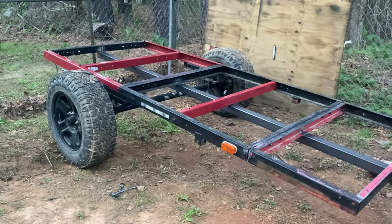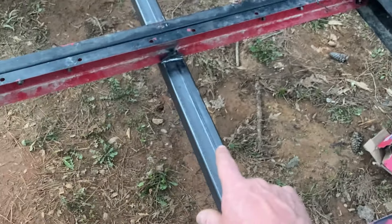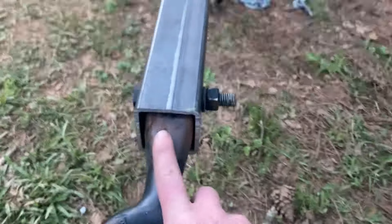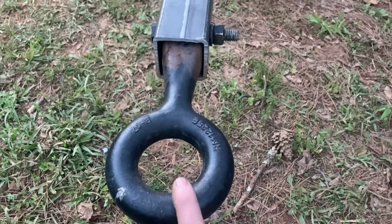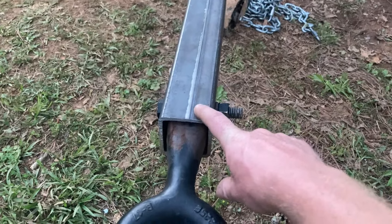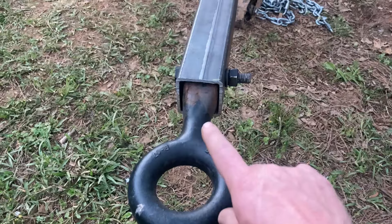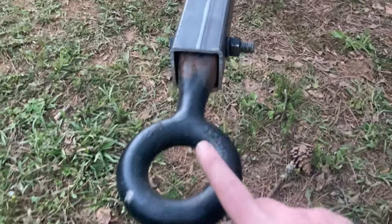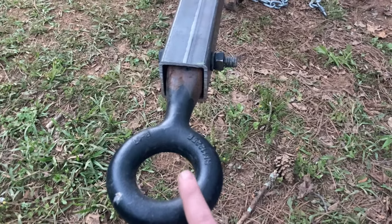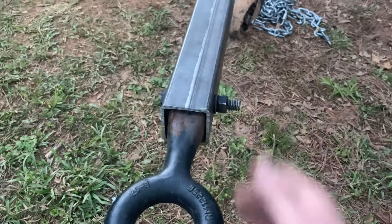I still have the 32-inch Jeep rims and tires with the 5.5 lug pattern and 3,500-pound axle from the original trailer. I've added a piece of two-and-a-half by two-and-a-half tubing with a 3/16 wall — that's the only tubing the steel yard sells by the foot. This fits the original lunette ring and also accepts the tractor supply two-inch ball hitch. I can swap it with one pin, and removing it is part of my security system — bare tube, nothing to pull with.